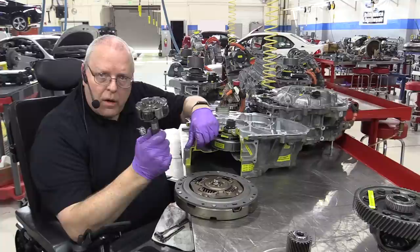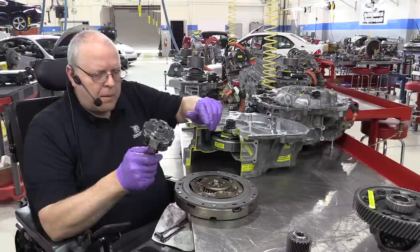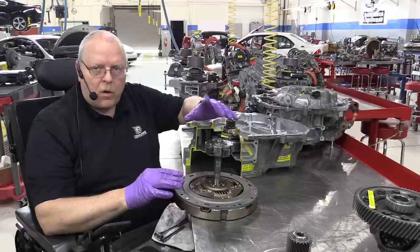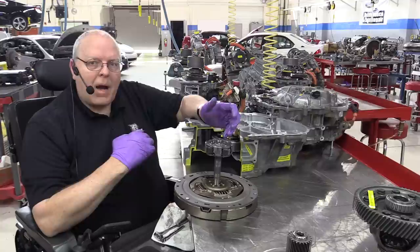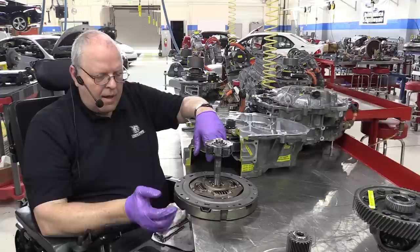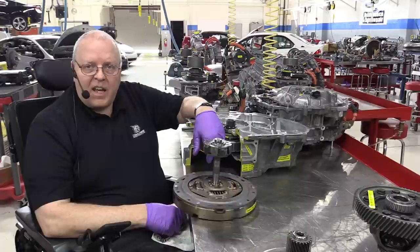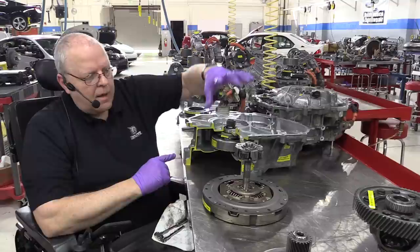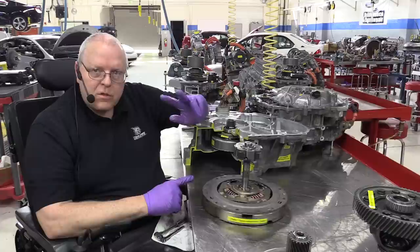But the planet carrier on the Prius, or on all Toyota hybrid transaxles, is connected to the internal combustion engine through a clutch damper, which limits the maximum amount of torque transferred from the engine to the transaxle, or backwards from the transaxle back to the engine. There's a clutch that will actually slip in here if the maximum torque is exceeded. And then of course there's a flywheel that bolts to the engine crankshaft and rotates at engine crankshaft speed. So out of the three pieces of a planetary gear set, we've got the sun gear that rotates with MG1, we've got the planet carrier that rotates with the engine, and then on the first and second generation Prius, MG2